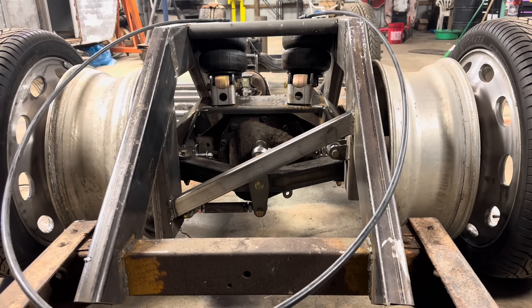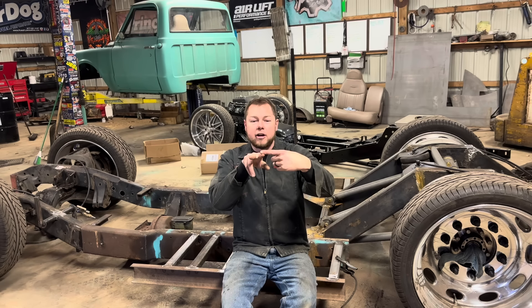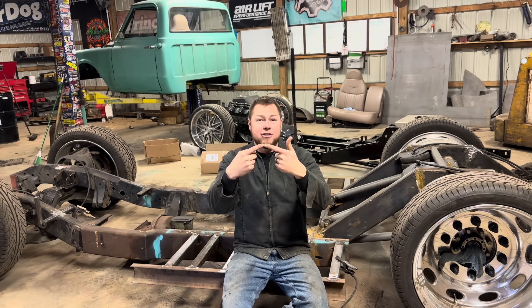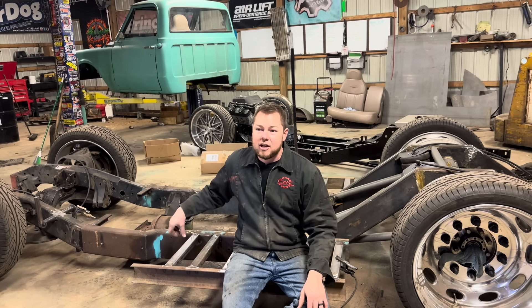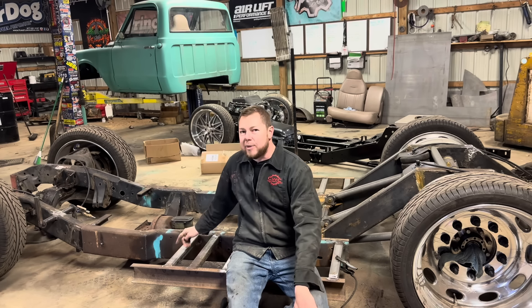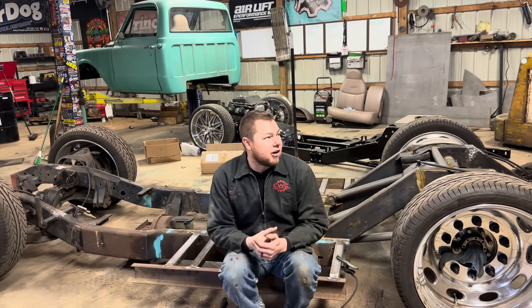If you're wondering what's going on on the outside of this frame - ever since I cut the center of the floor out for the driveshaft, the van's got a slight arch in it. So the frame rails are now sitting here, and by putting another set of frame rails here and over here it's going to force that van floor back straight. The van floor really isn't that bad - it's barely arched. By putting the outriggers on, it's simply going to bring it back straight. The blue spray paint was to figure out where these runners need to be, since they all match the floor of the van so all the weight of the van floor is also sitting on these supports. And this one has moved back to absolutely clear the brake booster. I guess it's really time to start disassembling this thing.